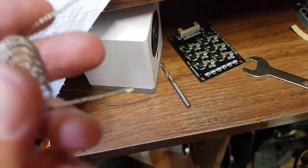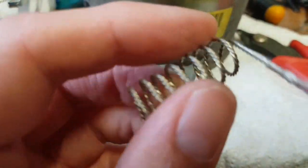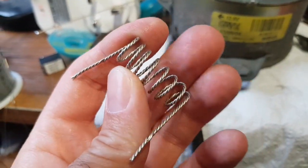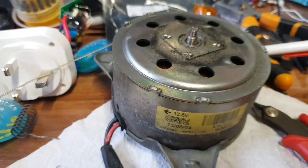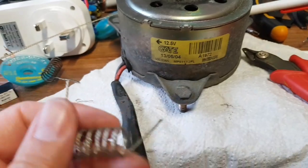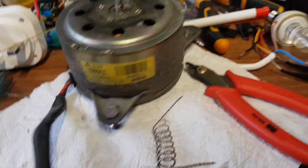What I do now is fit it back in there — just bending these tabs out of the way, feeding it through and squeezing it in. This is nichrome wire — nickel and chromium — it's high-resistance wire with a very high melting point. That's why it's used in heaters: fan heaters, hair dryers — that wiggly stuff is this wire. So you've got heaters in series with the motor to regulate speed. Incredibly inefficient, but that's what the original does. I was tempted to do MOSFETs and PWM control but couldn't be bothered.